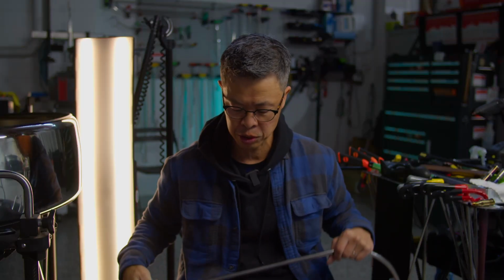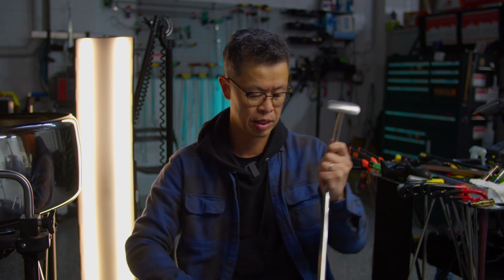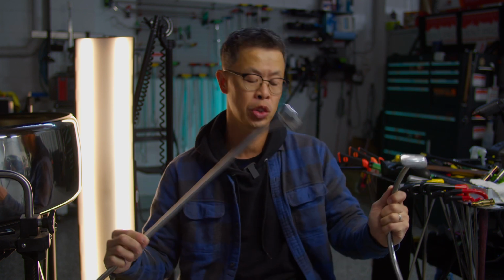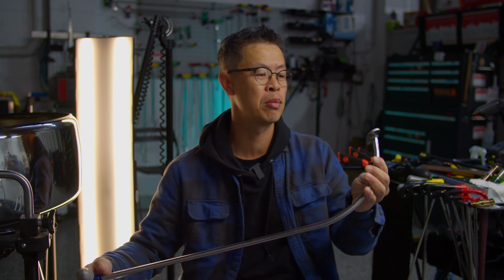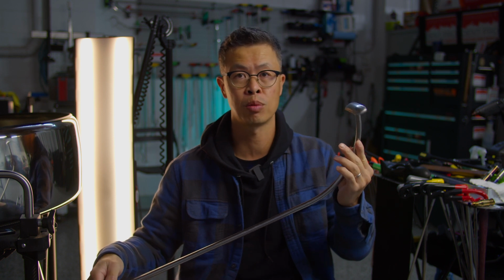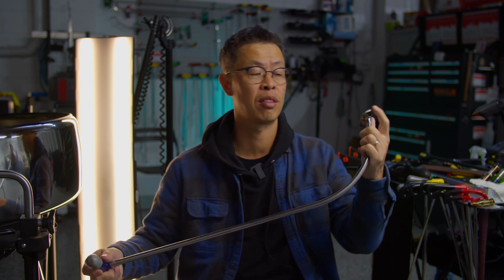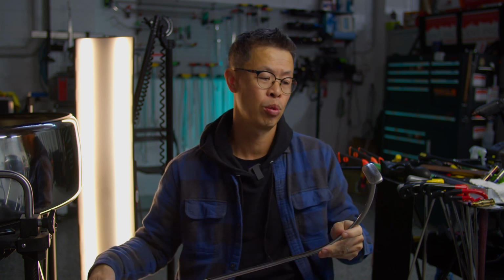Another thing about the Fender tool: the new head on these is going to look more like this. It's more oval shaped, and one of the things you can do with them is, if you're working on a large fender dent using this tool, you're rolling, and you need a sharper push at some points to finish it out, you can push straight up from the corners. That gives you some finishing ability with the single tool.